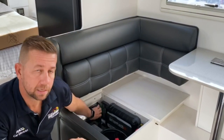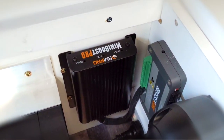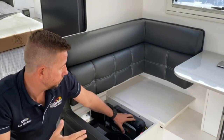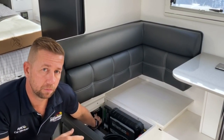We've added a DC-DC charger. Most of them don't come standard with a DC-DC charger, so we've added that to make the alternator charging from the vehicle lithium-compatible. That covers our 240V charging, which is just reprogramming, and the DC-DC charger we've fitted.